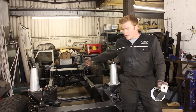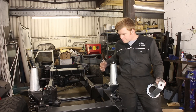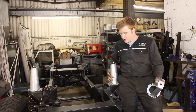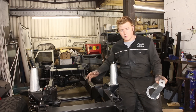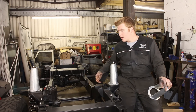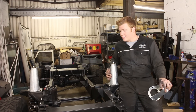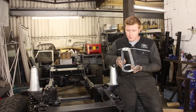Because of the way we're building the entire Land Rover to be as though it came from Land Rover itself, we're trying to keep it quite standard. I thought I'd put the old school cone shock turrets on. I went for galvanised ones because these do rust quite badly. I was fairly happy with that decision, but then we had some comments on the forum post quite rightly saying you're trying to do this better than Land Rover, and you put these old school closed shock turrets on — inside fills with rust. And you know what, they were right.